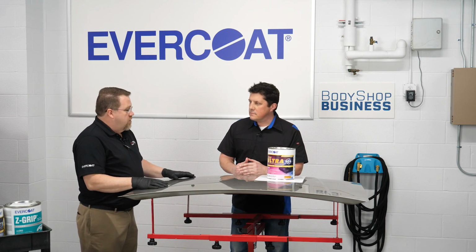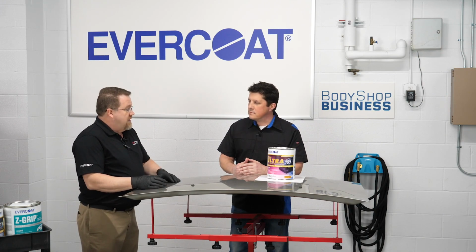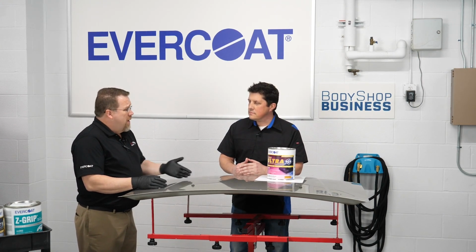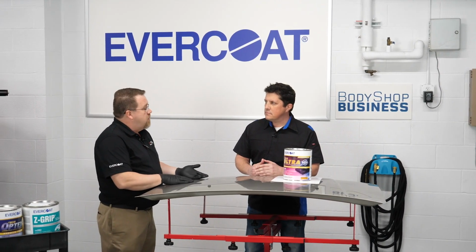Start off with soap and water to remove all the organic things that would be on here, tree sap, road salt. Then follow that up with a second step by using a wax and grease remover to remove the wax, the grease, the silicones, because those obviously won't come up with soap and water. And I even take it one step further and say clean the whole panel. That way you can make sure you're identifying all the damage in the one process. Maybe a good opportunity for an upsell in the process as well.